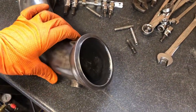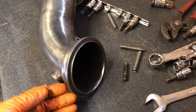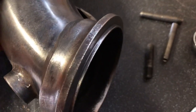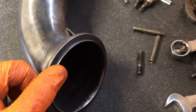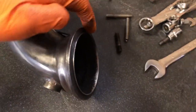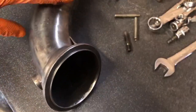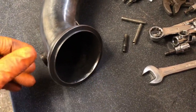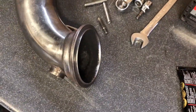On to the decat pipe. I get messages all the time about leaky decat pipes. One of the major problems is buying cheap decat pipes with no proper V-band connection. You can see on the more expensive ones they have this lip - this lip sits inside the turbine housing and creates a seal, stopping exhaust gases getting out. A lot of the cheap ones off eBay have a flat V-band with no lip, so they're always going to leak as soon as they move side to side. Never put sealant beyond the catalytic converter or beyond the sensors because you'll only damage them.